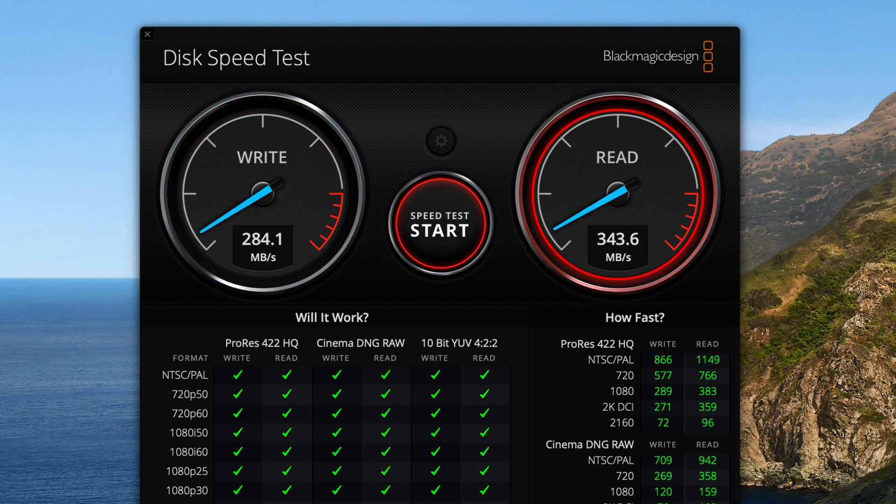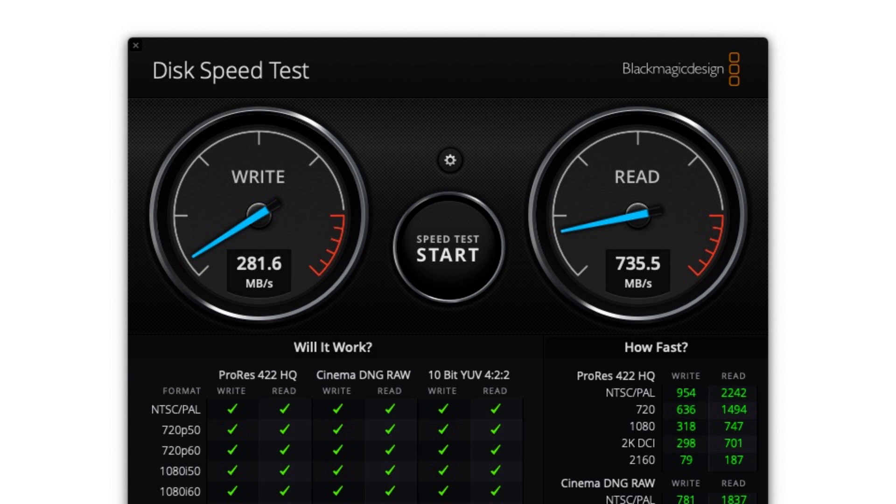The performance on this iMac is truly night and day compared to what it was. I can also show you the performance of the internal SSD component of the Fusion Drive on the 2013 iMac — potentially I could install my operating system there for twice the read performance, but I'm keeping things consistent, and it works really well having everything on one drive. Nowadays 300 megabytes a second doesn't sound like a lot, but when comparing this to my Fusion Drive it was phenomenally faster. On the face of it we were getting about three to four times more speed, but loading little files — which I do a lot as a web developer — it was phenomenally faster. It actually breathed new life into this machine. I'd recommend it for anybody.